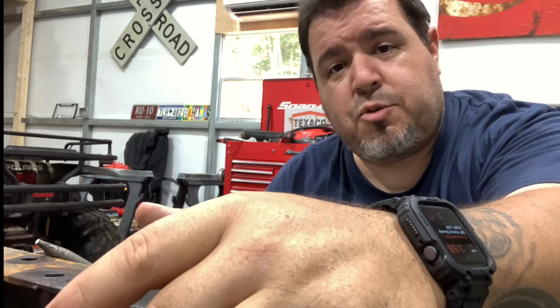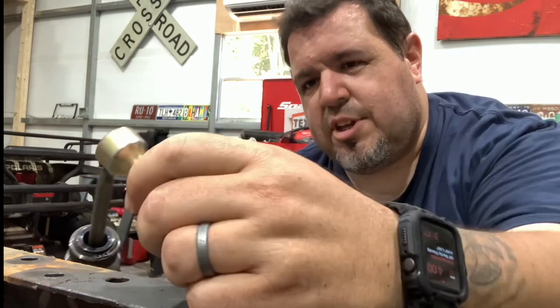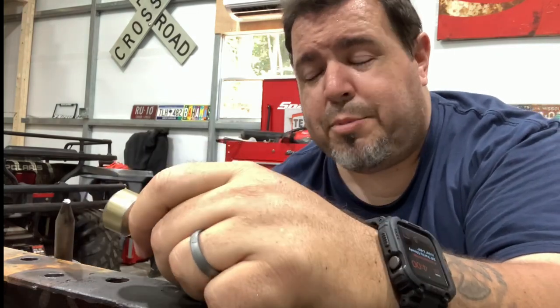What we're doing now is the slow and really annoying process of removing all the frame rivets in this frame. There are a couple of methods to remove them. What I'm doing right now is taking the grinder and grinding the heads in an X pattern, just so I can score them almost all the way down to the frame or whatever component is holding on. Then we're getting after it with the old air hammer. They were in there so good — nearly 70 years of rust. They're coming out, it's just taking forever. The only thing you've got to be careful with using the air hammer is if there's enough of the piece sticking up, you can tend to mushroom it and then it doesn't want to fit through the hole. You don't want to mushroom them up or gall them up too bad.